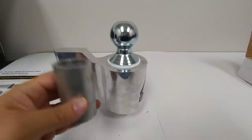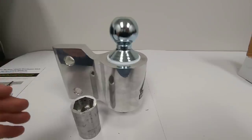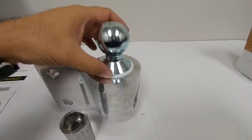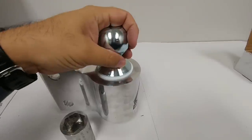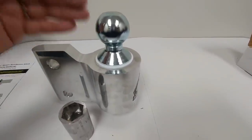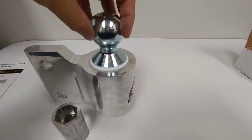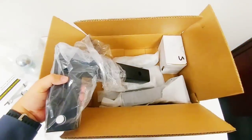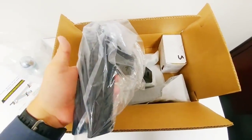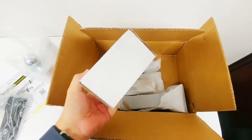It also includes this really nice socket designed to adjust your weight distribution system and the big nuts at the end of your chains, which help you dial in the right amount of weight distribution. You can see this collar in here — this is actually a friction collar. What it's designed to do is make it very difficult for this ball assembly to turn. That is the sway control. This is what's used to prevent sway from occurring between the truck and the trailer during high winds, adverse road conditions, or trucks driving by you. The inability for this to move easily is what creates sway control.